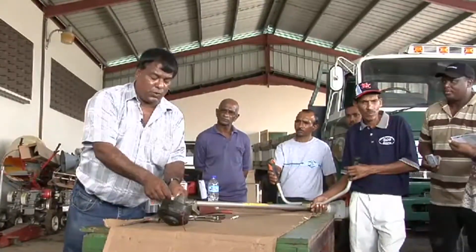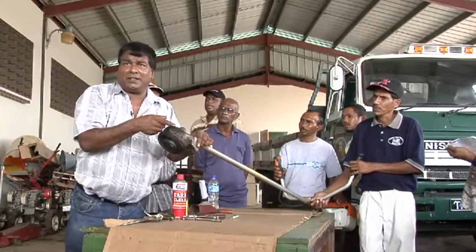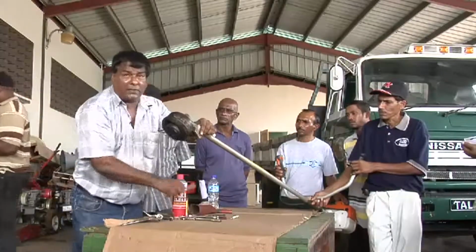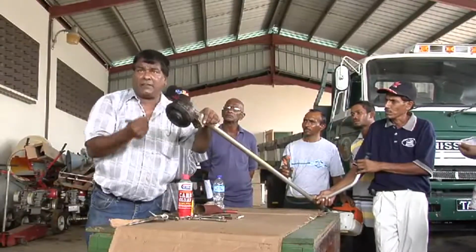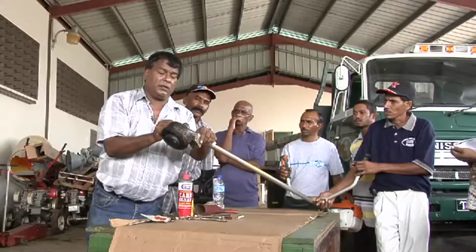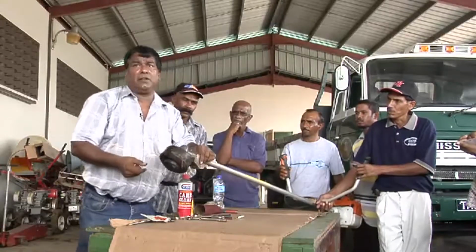You don't squirt so much that when you take this off, you see grease backing out. You must have a cavity for expansion. If you put too much grease, use a clean screwdriver or a clean palette stick or something and remove some and leave a cavity there. And you replace the grease plug after this. This is done routinely after every 50 hours. So you're going to inspect and add some grease every 50 hours.